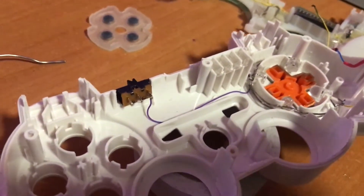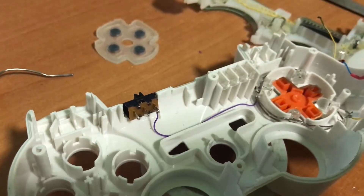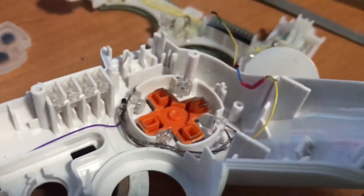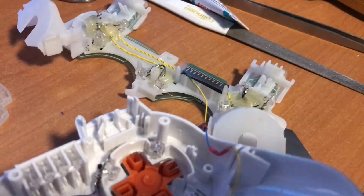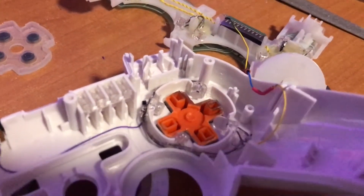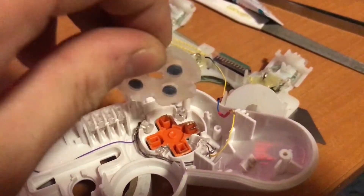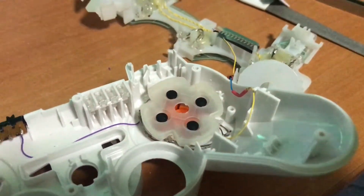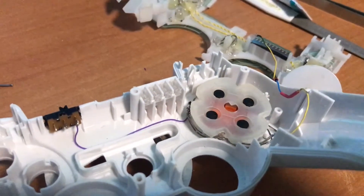So now I started on the wiring. I chose the right side — it doesn't really matter as long as the power comes from the middle. As you can see I'm running the negative lead to the bottom and positive is on top. That goes to what I already have pre-made, which I will show in a second because you need to probably replicate that too. That's how I make my d-pad light up. You can cut this so it fits better, but when the LEDs are properly in place it doesn't really matter.